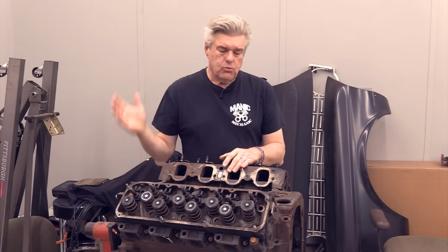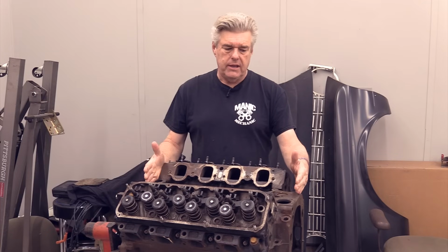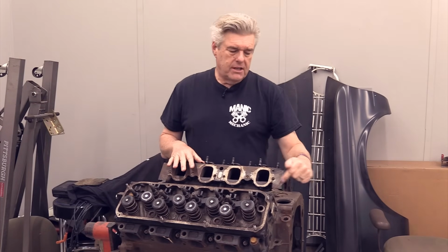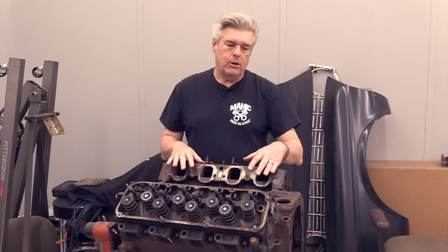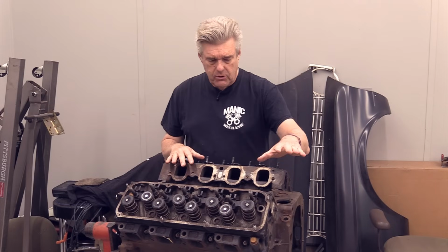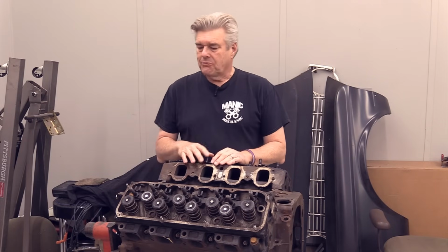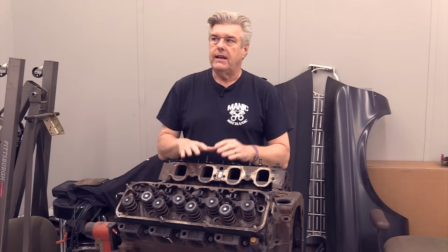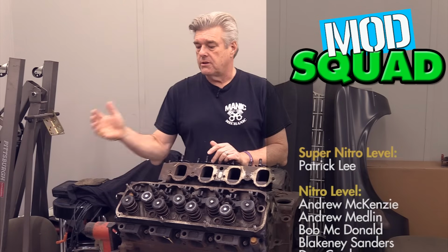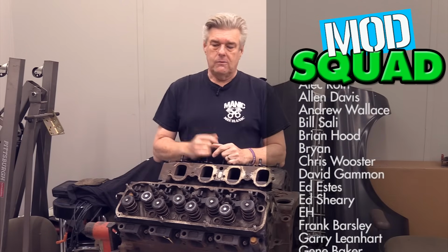That's really it. Just wanted to give you some heads up on what you will be looking out for when you're buying one of these. This is your biggest indicator right here on the front. Bottom line, this is the thing you're going to see the most of in most photographs that I've seen on Facebook Marketplace and anywhere else. You're going to almost always be able to see where the distributor sits, and you'll be looking for that little wall right there. The bell housing side of things, that's about a 50% chance of seeing those photographs. Some people post the photos of the bell housing area, some people don't, but that's a giveaway tell-all.